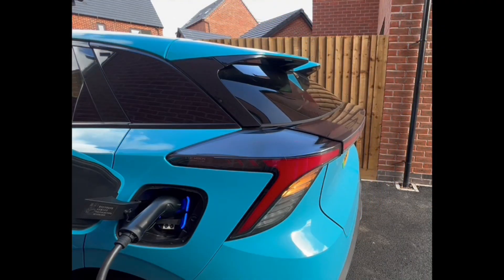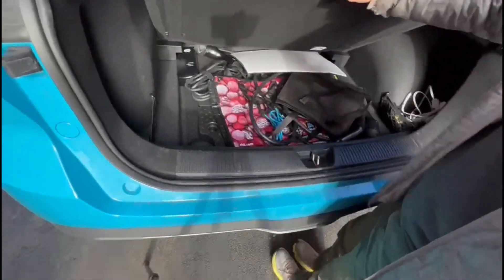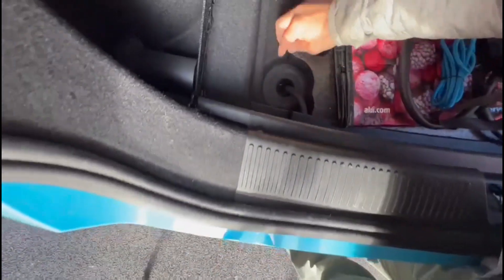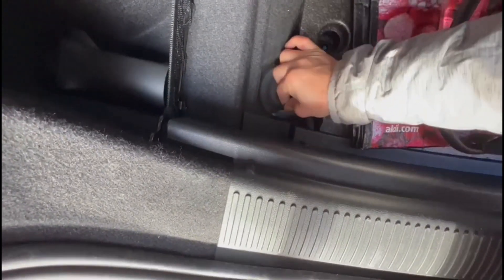Okay, so it has closed. Now I'm going to show you how I actually install the kick sensor. The module I'm putting in this area — you can see there's a round rubber there. I put the module all the way through this rubber, lifted it up, put the module over it, left the cable inside and connected it to the rest. It contains four cables in this module. One is connected to earth, which connects in that place there.